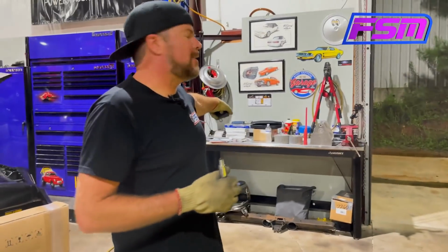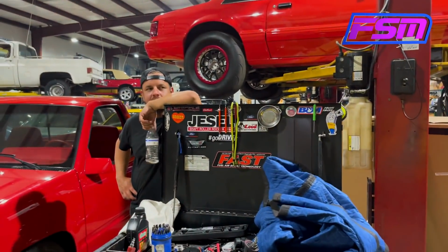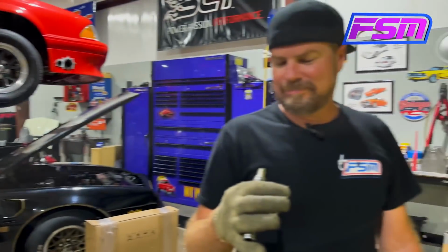836. Look at all the boxes of jets and air bleeds and stuff I brought with us, and we're not having to do anything. We don't need any of that. We literally just swapped pulleys. Your math said we were 12 underdriven, and now we're like 14 overdriven. 14 over. And yeah, I would take another degree of timing out of it, but fueling looks good to me. So, what did it make for boost?